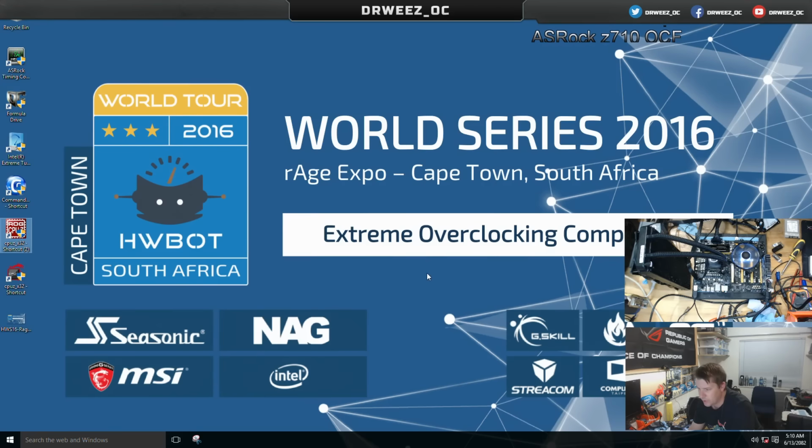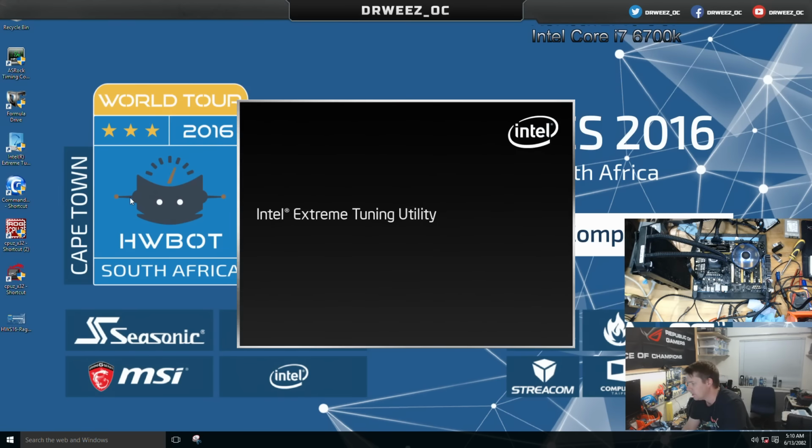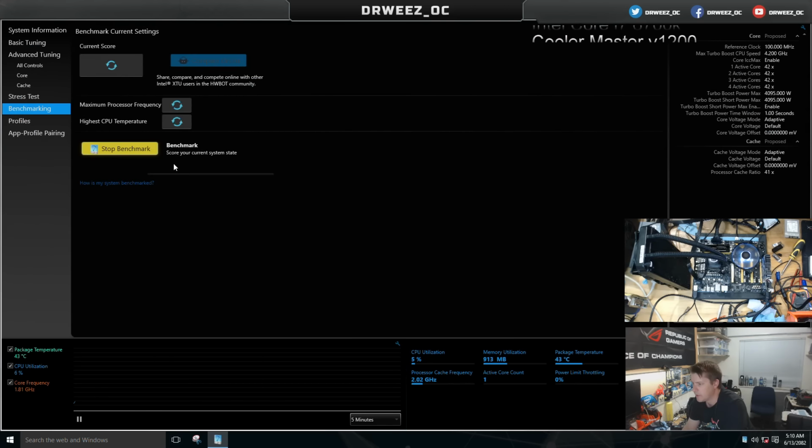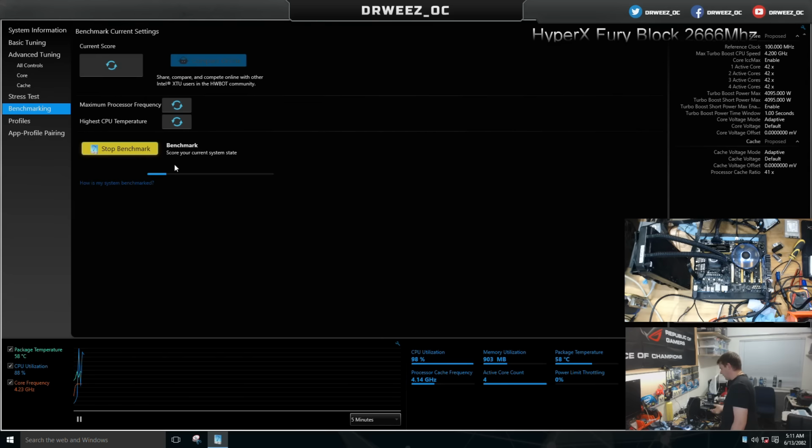So the very first tip I'm going to give you is the very first thing you need to do before doing any sort of overclocking ever is making sure that your system is stable before you start overclocking. Now, it's a mistake that we've all made many times before. We get set up, we start cooling down with liquid nitrogen, or we start overclocking, but we actually don't know if the system is stable. So what ends up happening when we do run into issues is a frantic rush trying to figure out what's going on. Meanwhile, it could have been something that happened before you started overclocking, which is throwing the whole system out of whack. So I'm actually going to start keeping some notes as well.